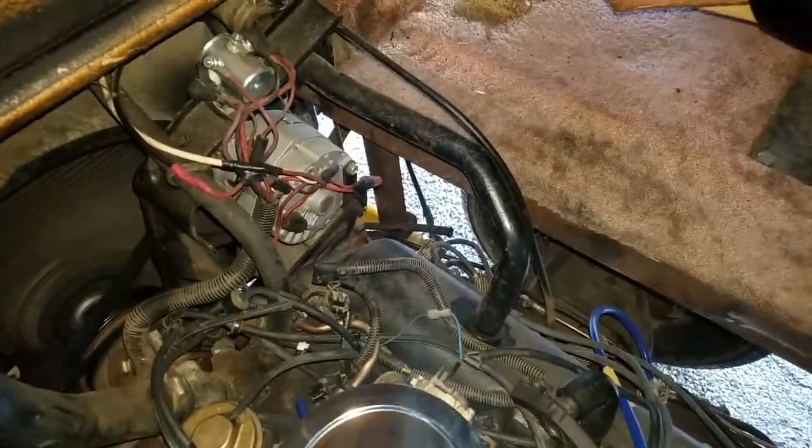You can see there — let me zoom in here. That is the fuel vent line. It's a solid line, then it goes to a flex line, then it went to the charcoal canister. What I'm finding when the weather's warm is that pressure builds up in the fuel tank when you kick the gas cap off — you can hear the pressure building up from the gas vapor.